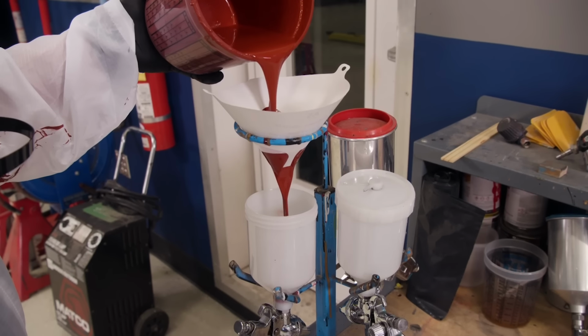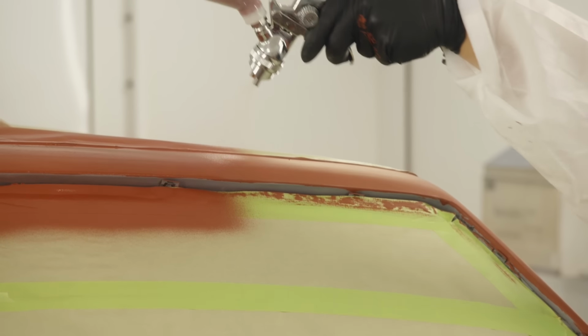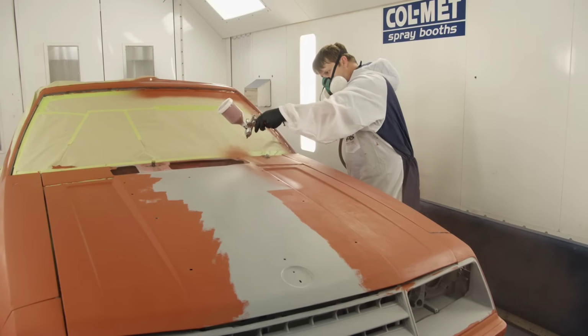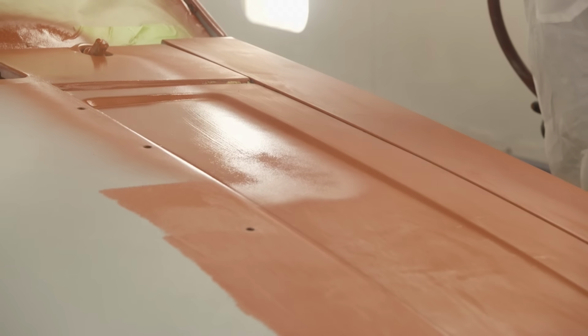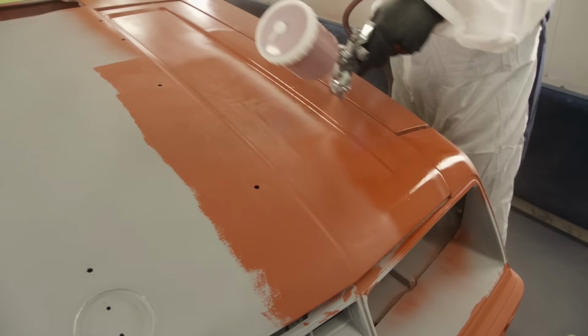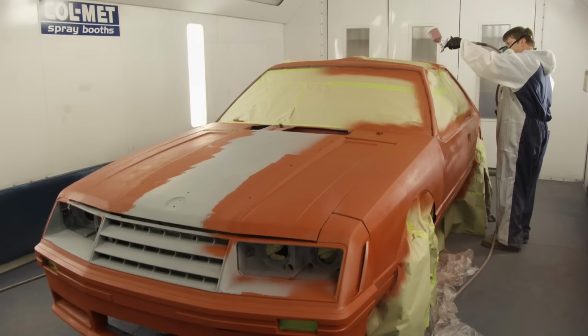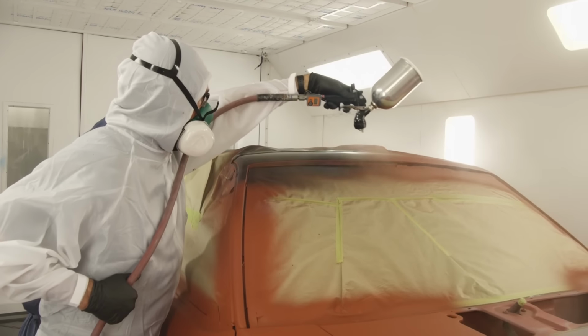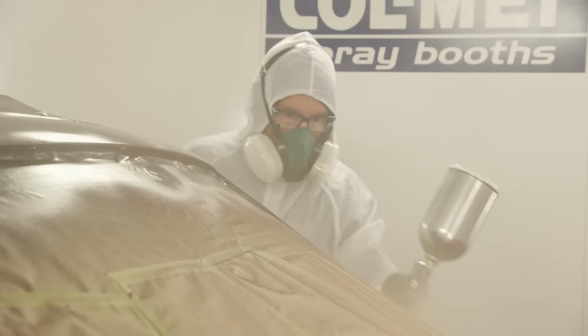I'm going to fill up the old paint gun and spray on one more coat of red oxide so that we'll have a heavy base to work with. And when we get started sanding, we won't sand through, unless we want to. Now when we spray the jet black, you will want to use more of the uniform and traditional form of painting. Nice even coats in one smooth pattern, making sure to cover all the red oxide.